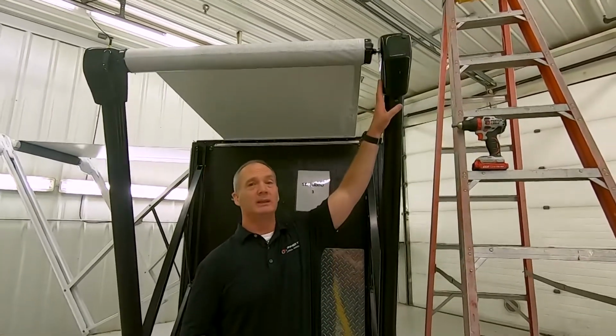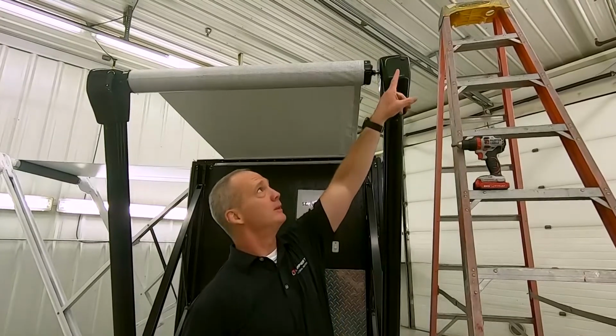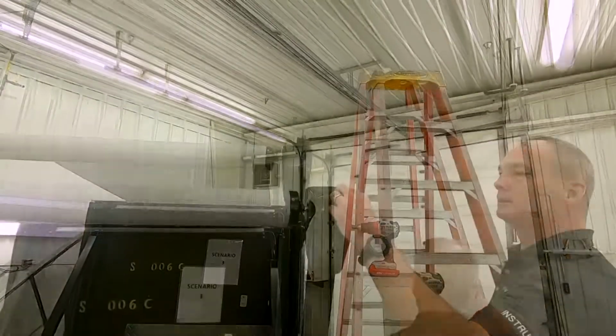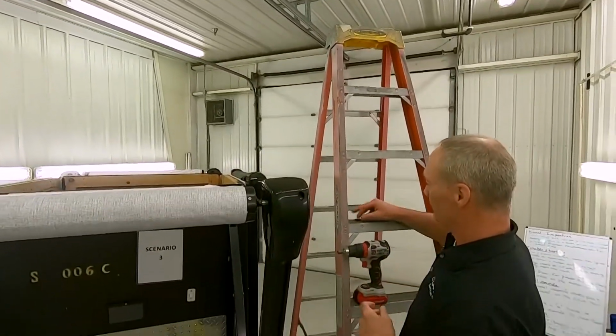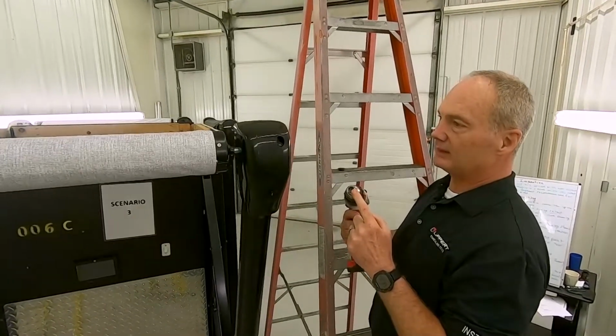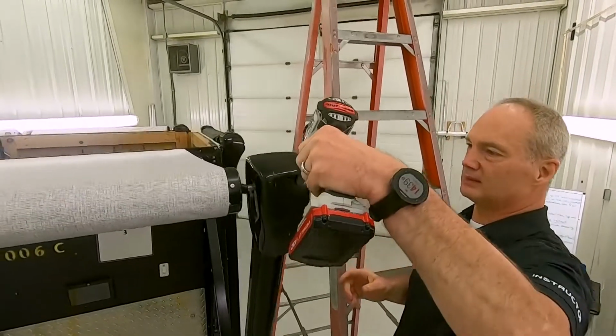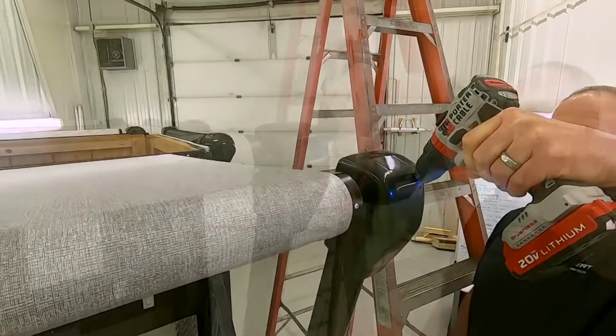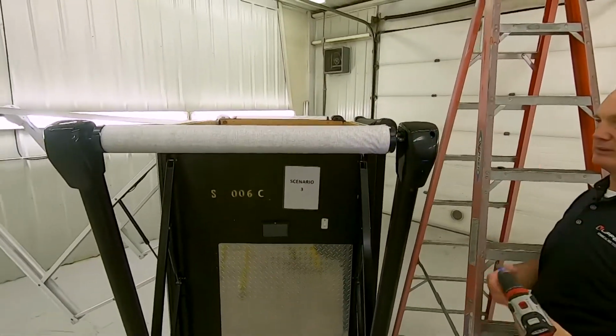In the event that you lose electric power on your power awning, you're going to want to utilize the manual override feature. Now the first thing you're going to do is locate that drive head assembly, and on the drive head assembly you'll see a rubber grommet on there. So let me take that off, put that away, and then you're going to take a 7/16 socket and place that on the 7/16 inch bolt in there and run it counterclockwise. That'll retract the awning.